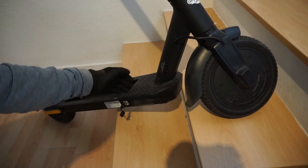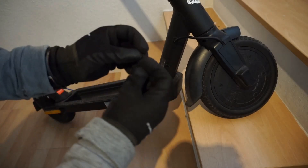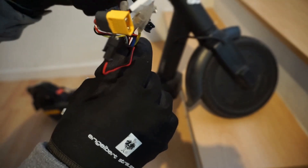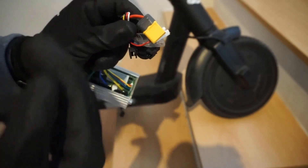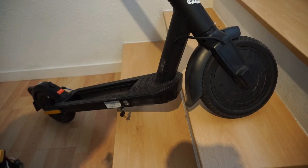At this point, with all these parts out, you push the controller forwards which exposes the wires at the front, and then you can simply disconnect them. There are plastic clips — six or seven of them — and you just go through all of them. Each is covered in insulation, so you simply cut the insulation off with scissors, disconnect them, and finally you will be able to pull the old controller out through the battery bay.